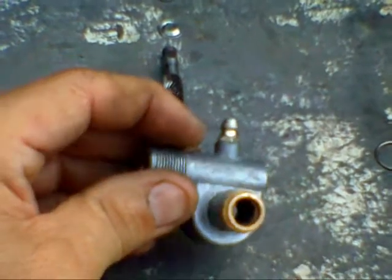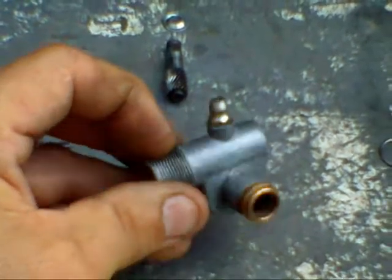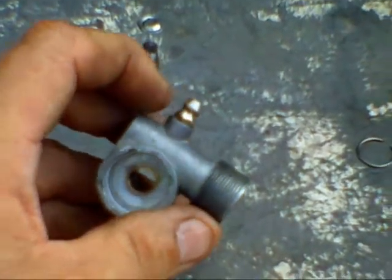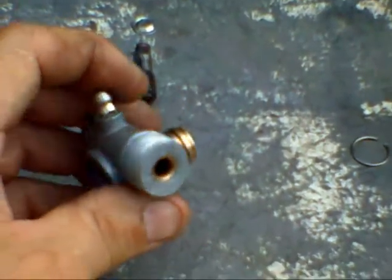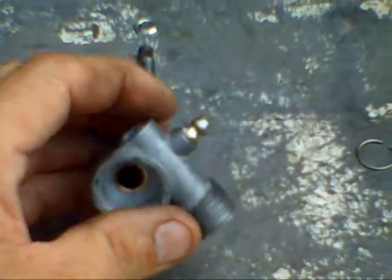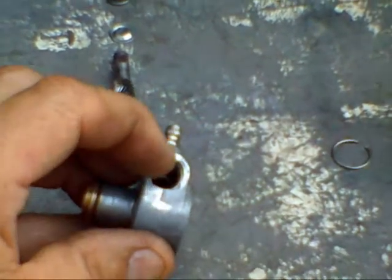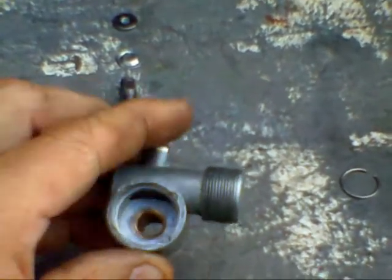This here is a Houston angle drive. It says DeLorean.com right there. This is the angle drive they were selling in the mid-2000s — not the angle drive they're selling now. The ones they're selling now have dimensional issues, fitment issues, and they do not have a grease fitting. These mid-2000 units have plates that hold everything in place after assembly, held on with four dimples. All you've got to do is knock the four dimples off and you can press everything apart.